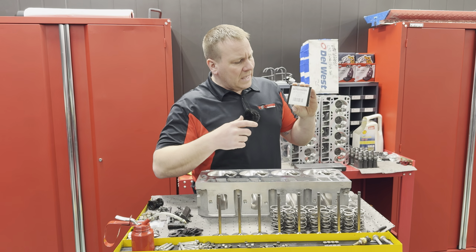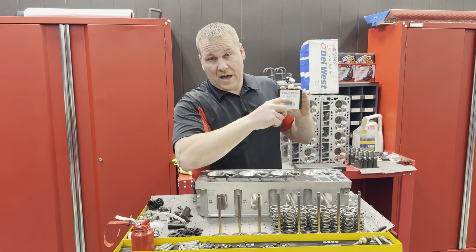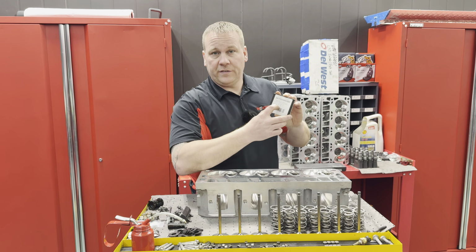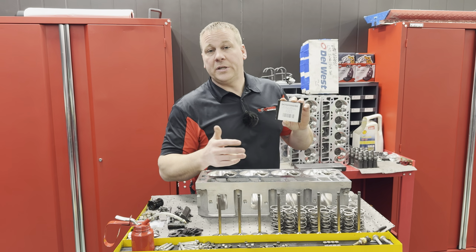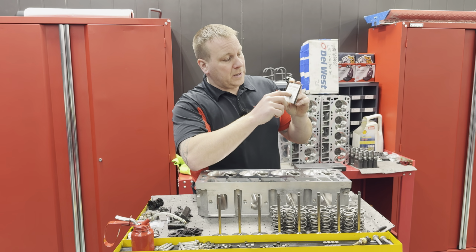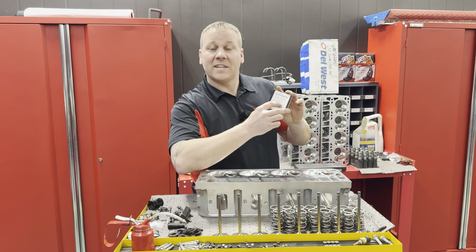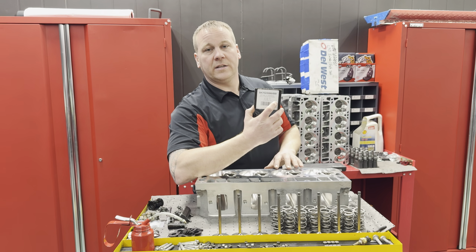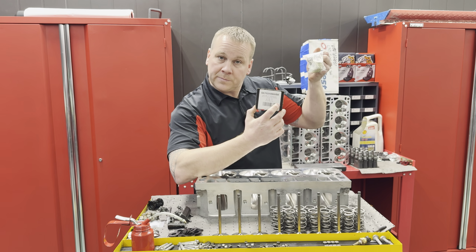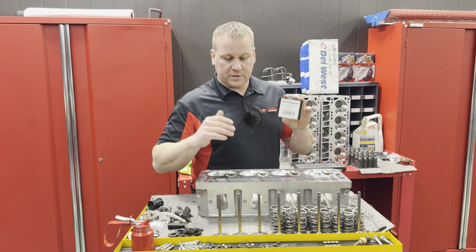So at the end of the day, I'm going to shoot for where our open is 1.115, which would give us 450 pounds of open pressure. If we add 0.66 to that, we would be at 1.765 or 1.775. So if this spring comes up at 1.8 inches, we would need a 25 shim to get it back to a 1.775, which is when the valve is closed, etc.